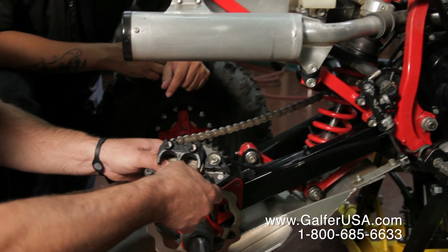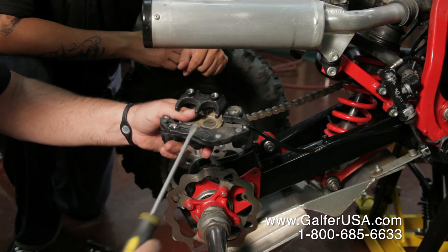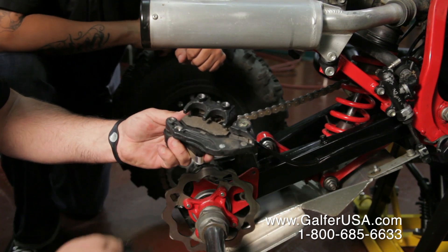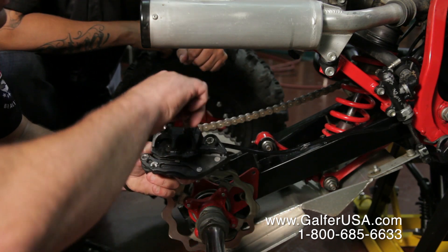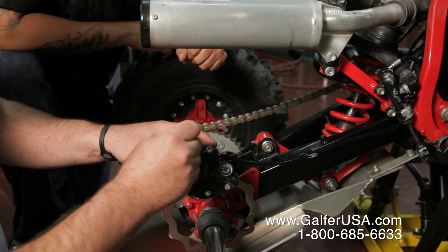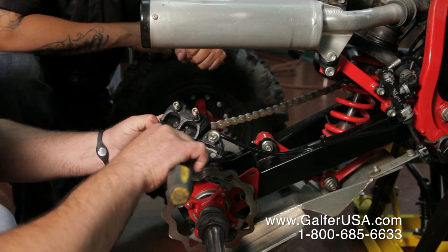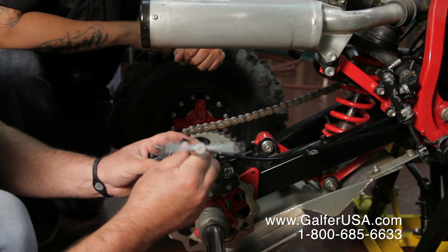The pistons are pushed all the way in. If your pistons are not pushing in easily with your hand, you can always use a screwdriver and just press down. Once the pistons are all the way down, go ahead and put the new brake pads on. Put the pins back on the system. Do make sure that the brake pads are sitting in the proper position — this is one of the big things about changing brake pads. We don't want to rush ourselves and we want to make sure we're putting it all right back where it belongs. You don't want to have a brake pad drop on you while you're riding.